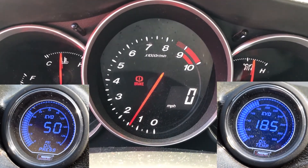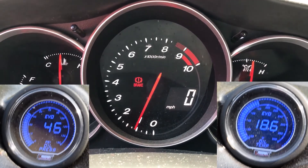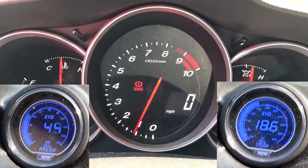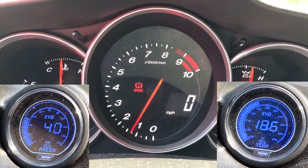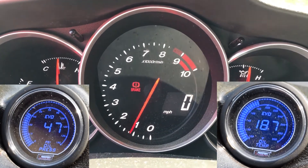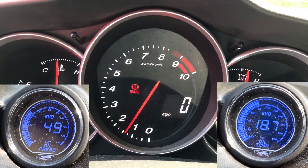About 1250 RPM is right about there, sitting at almost 50 PSI of oil — just a touch under 50. Yeah, about high 40s is what the oil pressure would be when she's idling right about there.